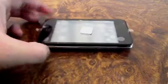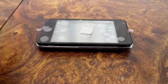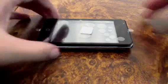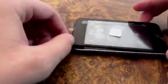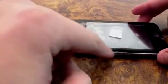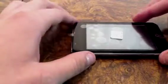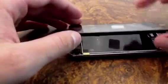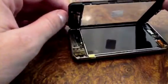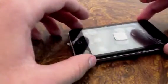This is actually not even my iPod, it's just one of my family members that I'm doing it for. But anyway, I'm just talking about how to test your digitizer before installing so you don't waste a bunch of time and possibly mess up your gasket/mid-frame if you have to take it back out. Because they are a pain to take out and very easy to break, so order this as a full front assembly kit with the button and everything already attached, because it just looks better that way.